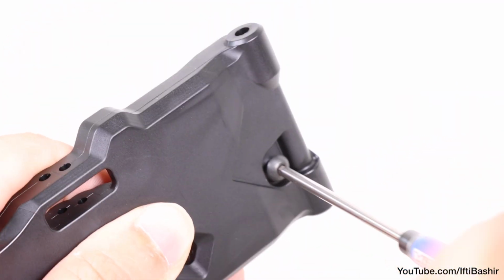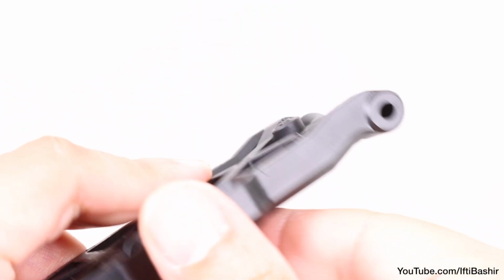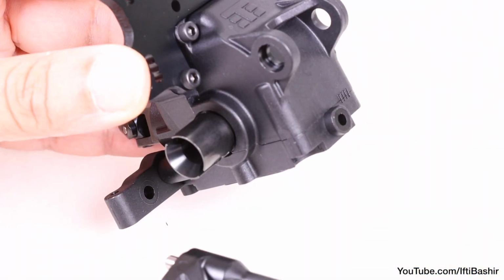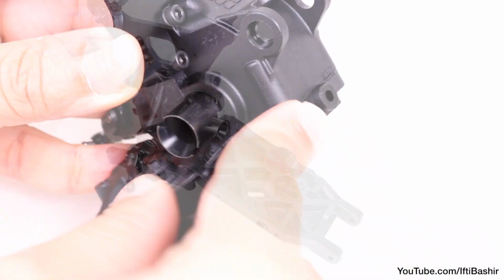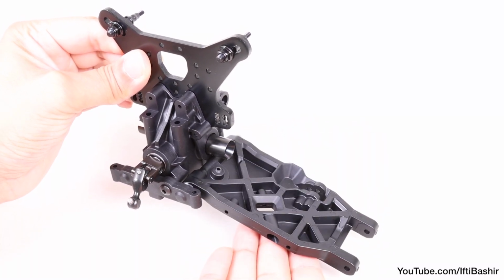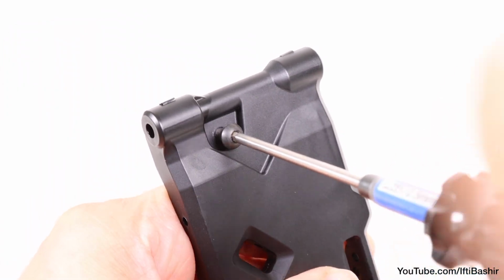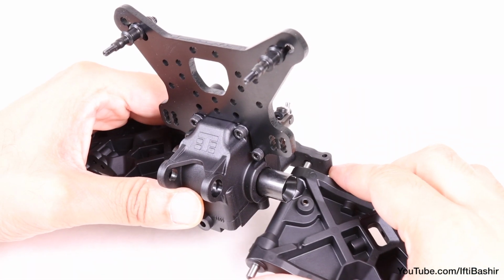With that said, we'll move across to our first arm now, where we insert the 10mm droop screw into the inner centre, followed by the hinge pin itself straight through the larger end, and seat into position, into the hinge pin brace we just installed, pushing the hinge pin right back into the brace. No reaming required and the arm should be relatively free moving. Repeat with the second arm, so 10mm droop screw, hinge pin, before securing to the opposite side.